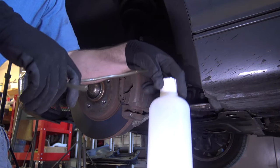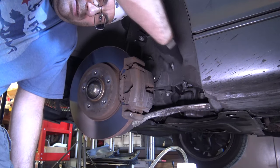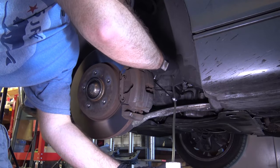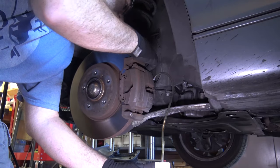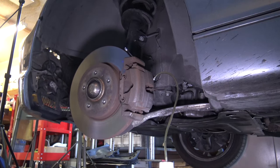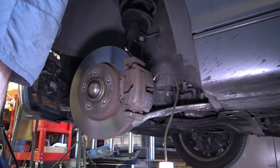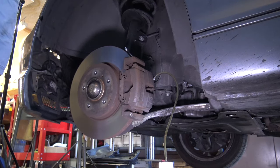I've got a little container with a rubber tube. Up here is the bleed nipple — there's a little cover you peel off. It's a 9mm wrench. I'll put my tube onto the bolt, knock it loose, and just let it gravity drain. I was going to use the brake pedal to pump it free, but I can't because I already took the master cylinder bolts off. So I'll just let it gravity drain — it'll just take a few minutes longer.